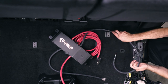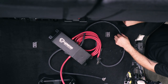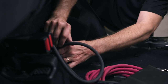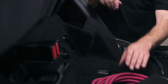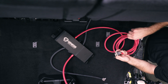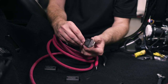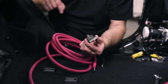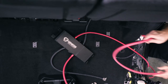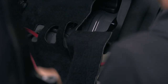We'll uncoil these wires. We can pull this carpet back from under the seat mount brackets right here just a little bit — I like to run these wires right through here. This is the long cable — it's going to go up to our cranking battery and it has got an inline fuse on it. So in order to get this through the body, let's just remove our wire from that fuse. We'll put this back on when we get under the hood. Let's take our positive wire and go through that same spot to get behind the carpet and pull all this slack through here.